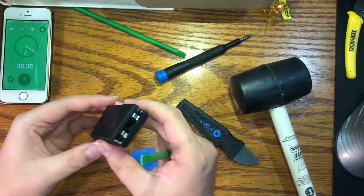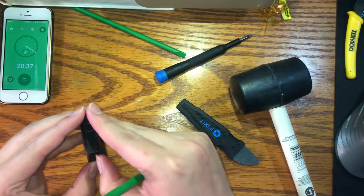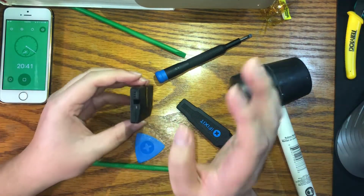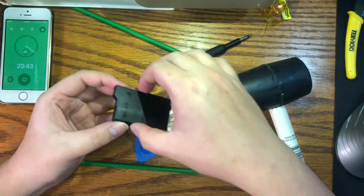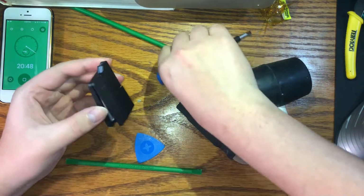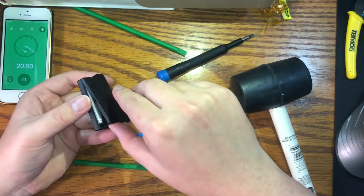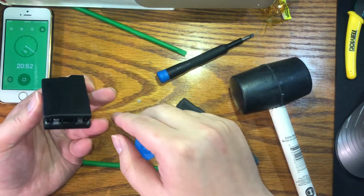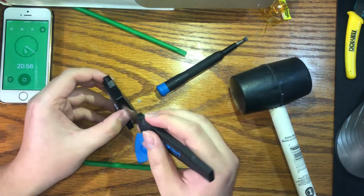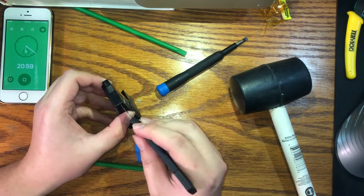As you can see, I only have that top weld left. Now, as tempting as it might be, don't just straight rip it off like the Hulk. The plastic shell is really brittle, or at least it was on mine, and the weld is way stronger than the plastic, so if you yank it off, you might break the battery shell beyond repair, and you might not be able to reuse it. Instead, just keep working to separate it like you did on the previous 3 sides.